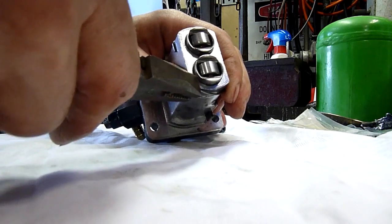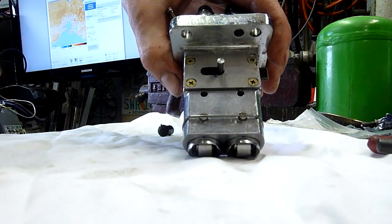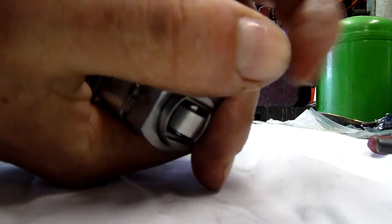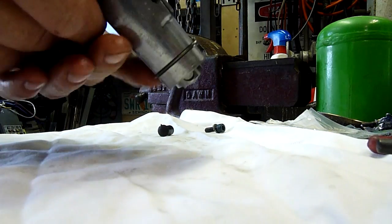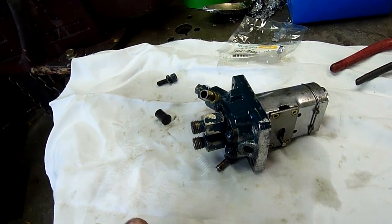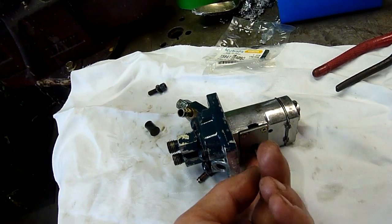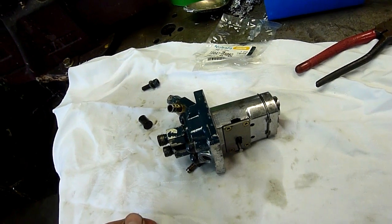There we go — that's it. Each one of those works. That is a clean and assembled pump. Now I've got to put it back in and test it. I'll do the throttle shut-off test — make sure that it cuts the fuel off when I turn it off. That'll indicate if things are correct; if they were completely out, you'd never be able to shut the fuel off.